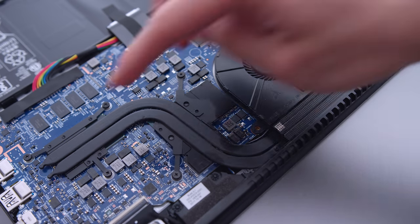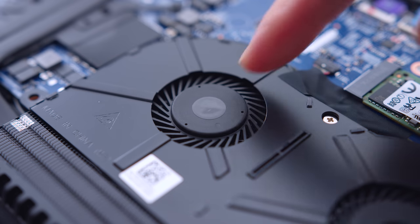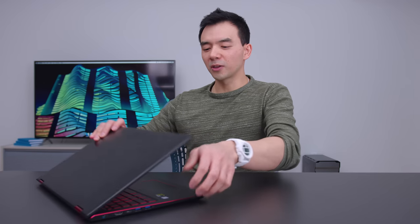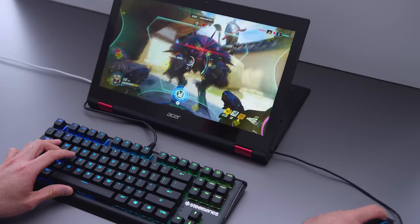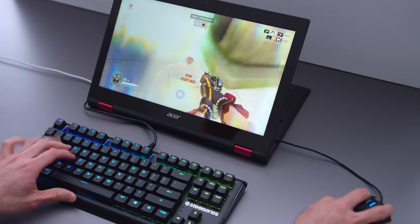I think the problem comes from the heat pipes. We've seen this design on other Acer laptops where the CPU and GPU run in series — it's just not the best way to cool it, though it is cost-effective. Because it's only a 15-watt CPU, it doesn't put out crazy amounts of heat, so they can kind of get away with it. Something interesting: if you play games in presentation mode with an external mouse and keyboard, the thermals are actually a little better. You don't need to play like this, but you can, and it's actually more comfortable than it may seem.